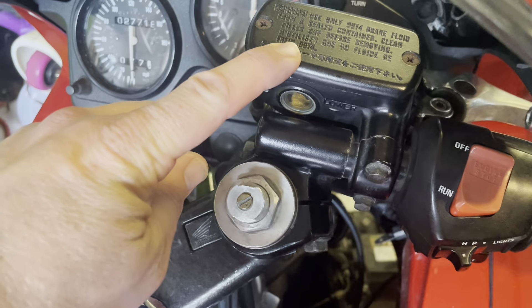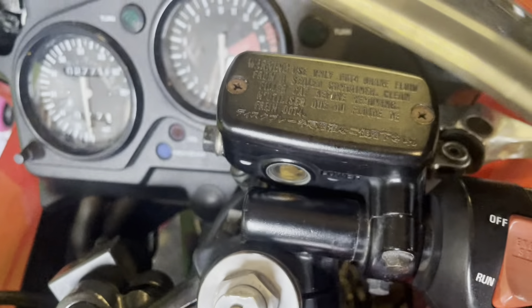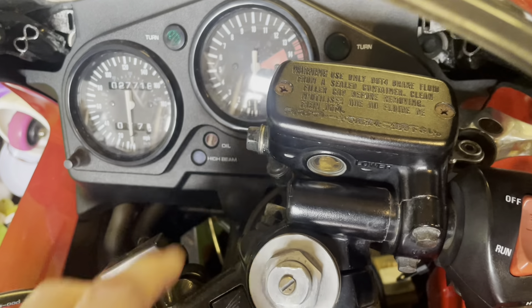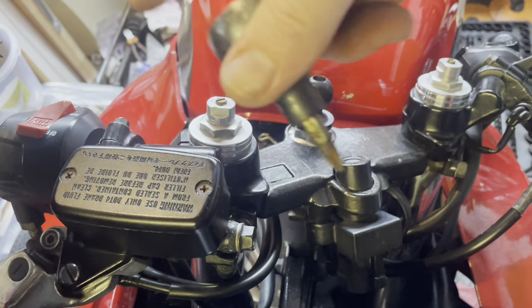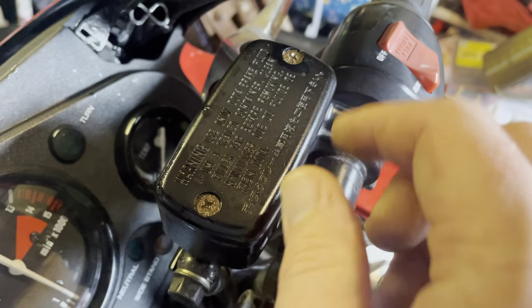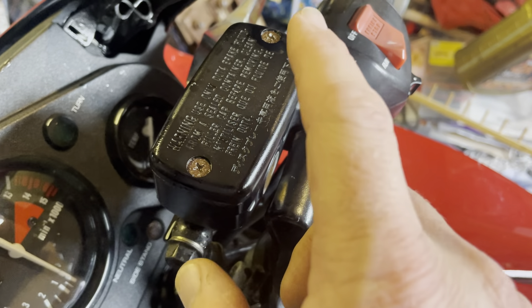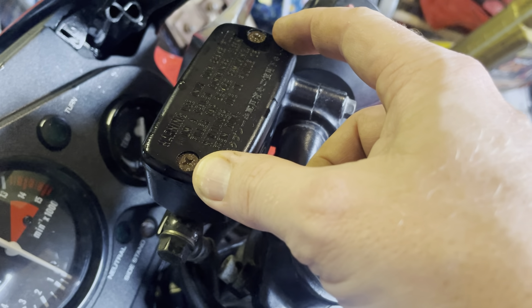This is the brake fluid reservoir and it's held in place by these two screws at the top. Because I'm going to have to refit the mirrors to put this back into road mode, I'll take these bolts out and pop the screen off so I can get a proper screwdriver head with a ratchet on the back of it and apply some force without ruining the top. With the screen removed, we can get straight onto the top of that and pop them off nice and gently. These are now moving nicely, which means I can take the lid off and strip the caliper. I can take the pistons out and re-bleed it — it's not a problem because I can get brake fluid back into the system. If these were rounded off I wouldn't be able to re-bleed them and it would have been an absolute nightmare.